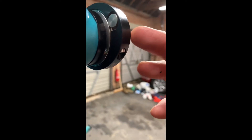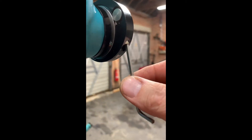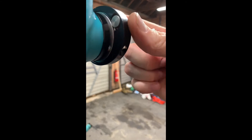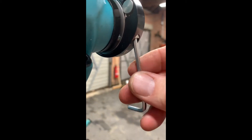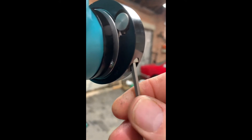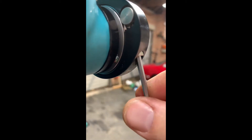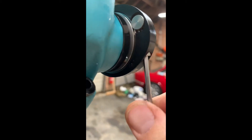This little eccentric — you have to pop this on first, then pop it in through the back and do the little allen key up afterwards. You can't put it on first and then mount it because of a little lip. So: this on first, then pop that in, rotate it with your fingers until you can feel the allen key biting, then it pulls down and secures the position. Just do it up lightly — literally finger tight.